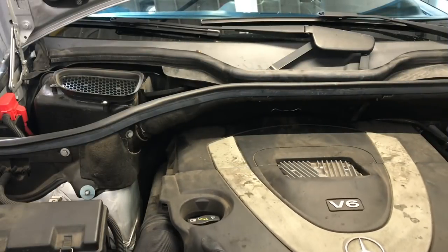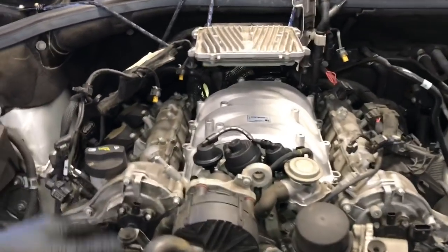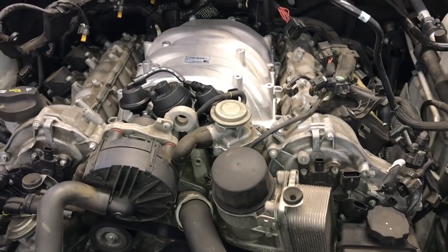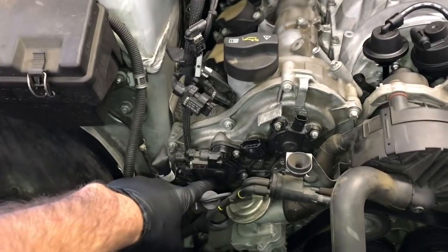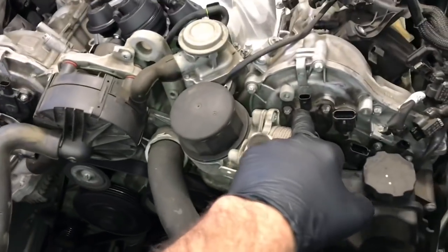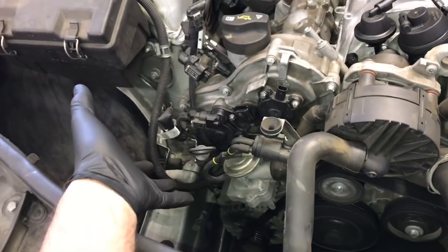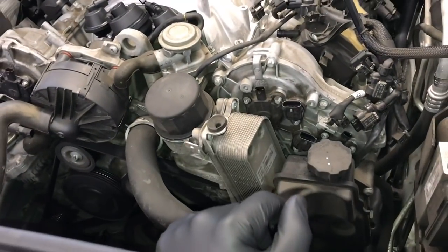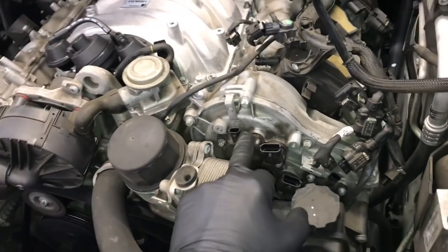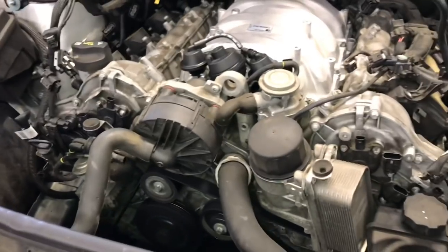The first thing you need to do is remove your air cleaner assembly. It just lifts off — it's pressed on, so there's no bolts or fasteners. I'm doing other repairs on this vehicle, which is why you'll see it in this state. Once you get the air cleaner off, I'm going to show you how to change out the intake and the exhaust adjusters. The top one is the intake and the bottom one is the exhaust cam adjuster. I'm not going to show you the left side — that's the easy side. I'm going to show you the hard side, and you can just duplicate it on the left side with less disassembly.